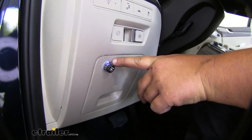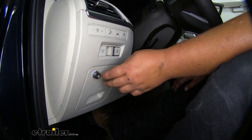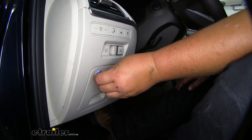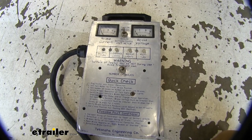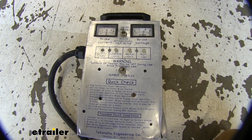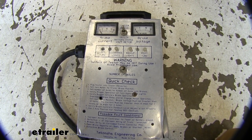Here's the LED light I was talking about — it's going to be really easy to see whenever we're turning our dial. We can manually override it so we can just stop the brakes if we want. We'll put it on two and we get a nice pink-colored light because the power is low, and if we crank it all the way up to 10, we're going to be adding more power to the brakes and we get a nice red light. With it on the second setting, I'll press the manual override — you can see it pushes a little bit less volts. Then we can crank it up to 10 and you'll see those volts jump up.